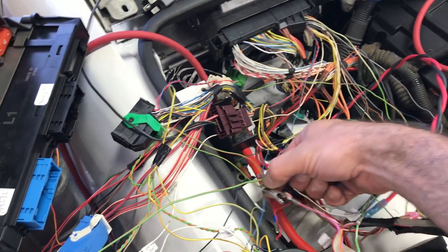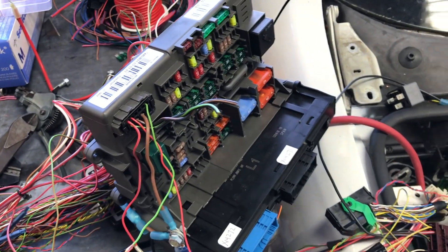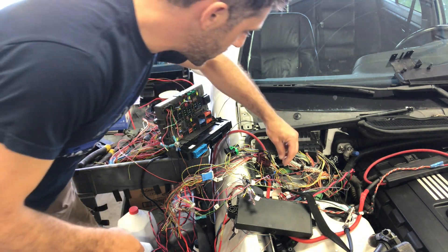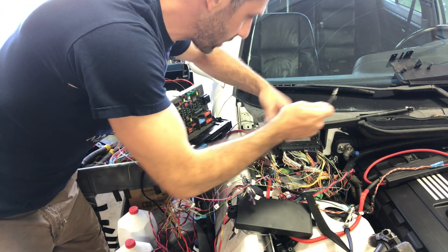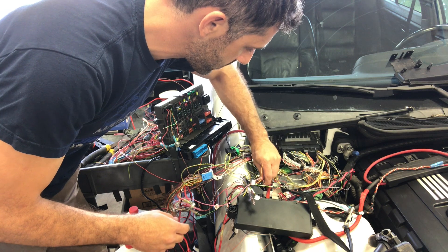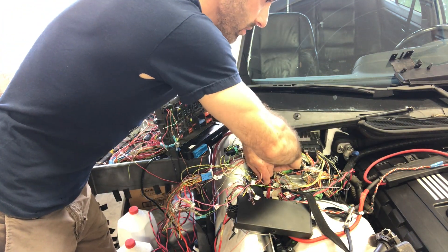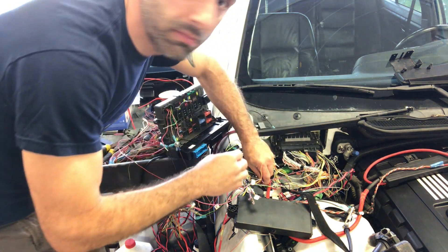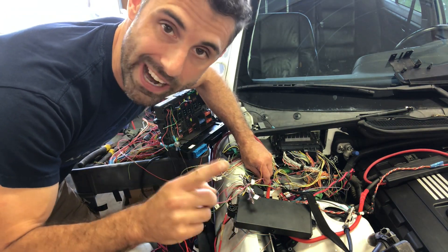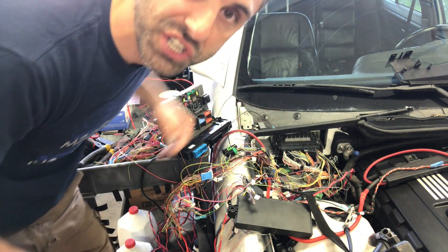I am further isolating this junction box by turning everything to 12 volts manually. This is the DME wake-up wire — if I connect this up and jump it to positive 12 volts, everything wakes up. I'm going to set the phone down and start the car again, further isolating this junction box. Let's hook up the wake-up wire to positive 12 volts, push the button and try starting it — and it runs. Until I remove power to the wake-up wire — that stalls it out. That's how I shut it down.